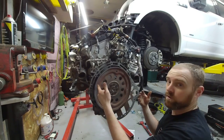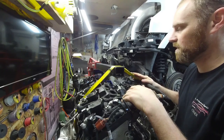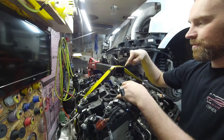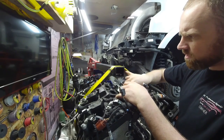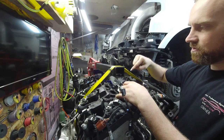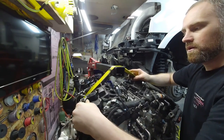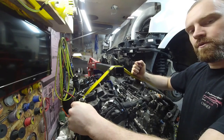After putting that in I'll be ready to put this thing in the vehicle. Now I told you this would be a little sketchy, but I did find a way to make it less so. I have a bolt going through here where I would normally hang the chain, but because of the height restriction I have to put the arm underneath. I have a heavier strap going across with a little less stretch, and I used mechanics wire — looped around the bolt a few times, twisted it together, nice and tight — so it can't slide forward or back, but I still have a little wiggle room left to right to get it into place.